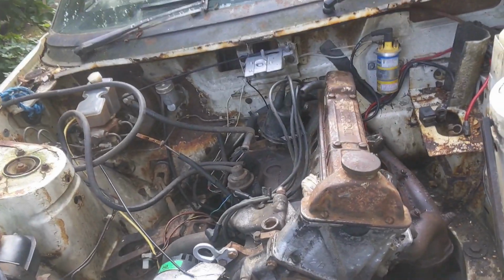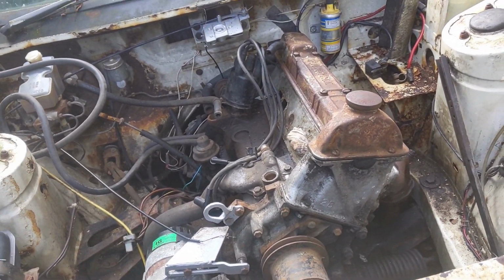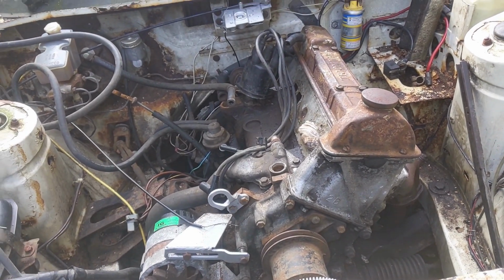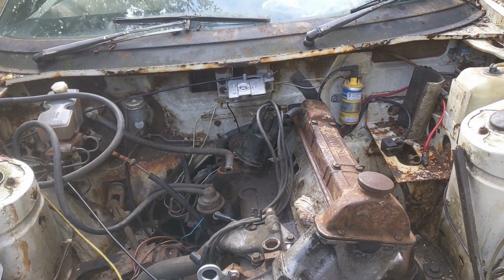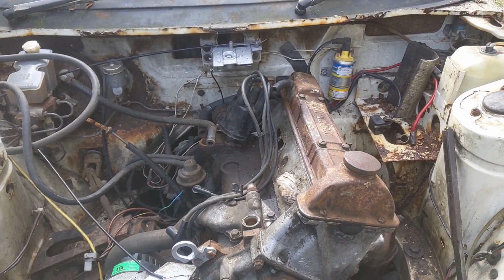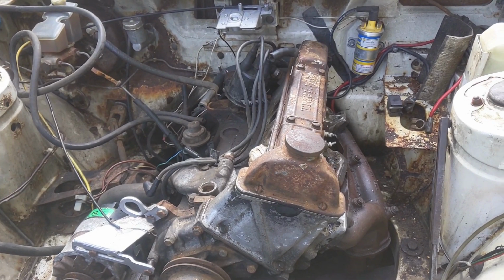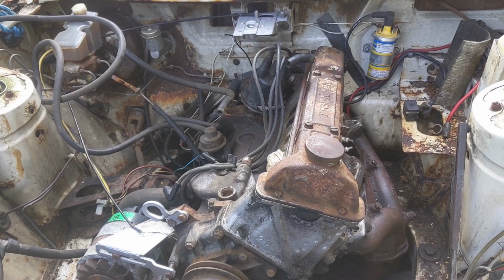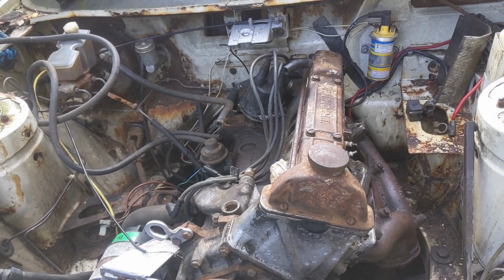So we decided to leave it there for today. We've put the rocker cover back on. We took each of the, what are they called, John? Camshaft bearing caps. We took each of those off, or at least we took 7 of them off, the 7 where the springs weren't springing back. And we squirted a bit of WD-40 down each of those and covered them up again.